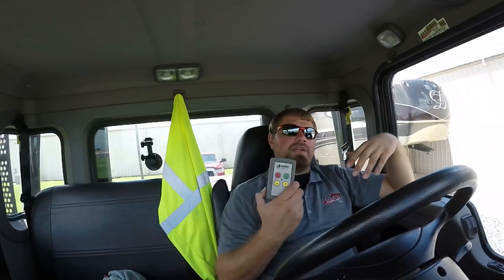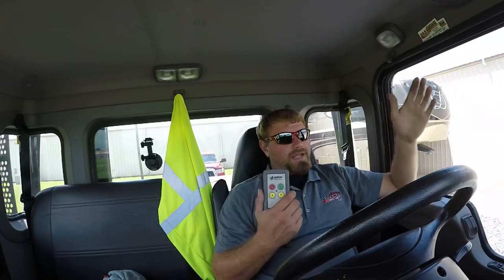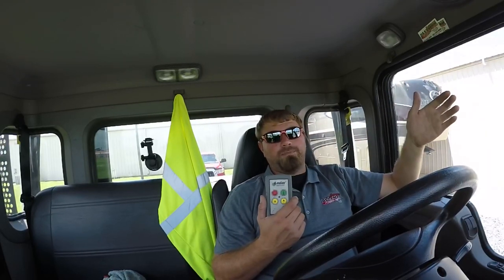A con is, if you're anything like me, you want your winch cable spooled up straight. I hate a winch cable that's crossed up. Doing this, you're going to have to spool your cable about half to three quarters of the way up the bed. If you have a remote like I do, you can hold it and put pressure on it before you load the vehicle, and that'll keep it spooled up. So that's another con of it.